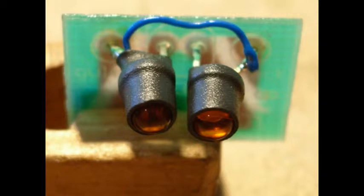Because you don't want light transfer between the two LEDs, I've used some shrink wrap around each of the LEDs and then shrunk it on very carefully. Because these are not close to any sensitive pieces of equipment, I used a hairdryer to shrink them on. I've normally not used a hairdryer in a locomotive because you could melt all sorts of things, but on this here there's no problem.